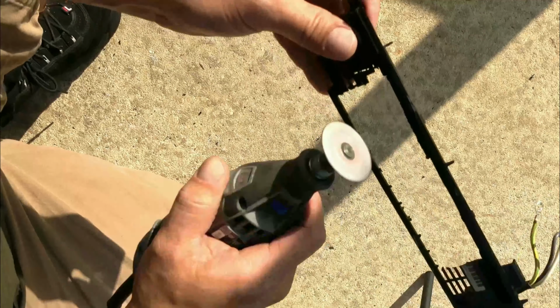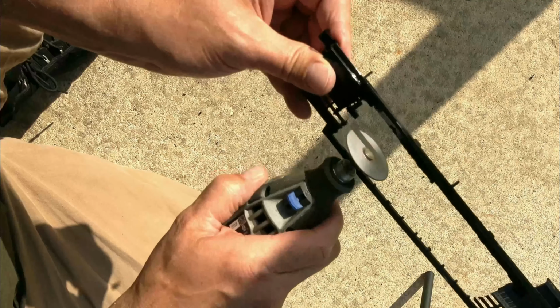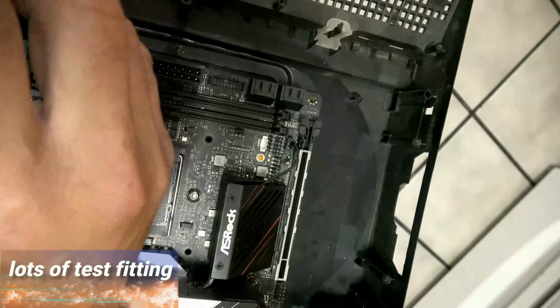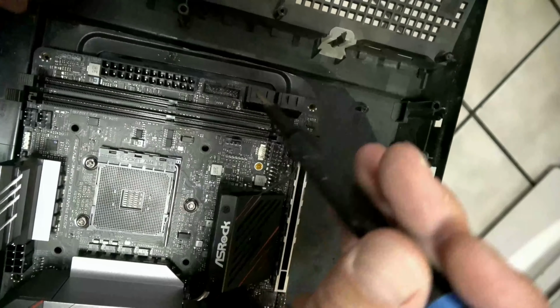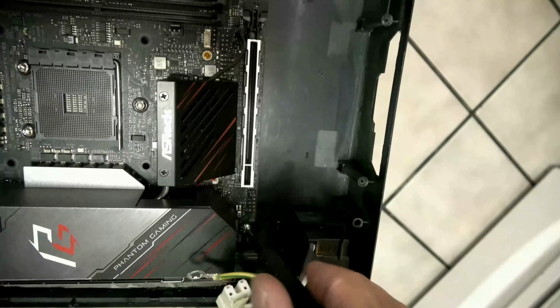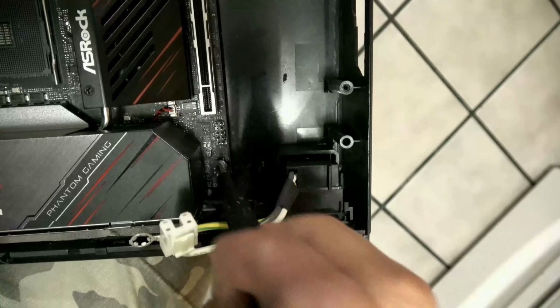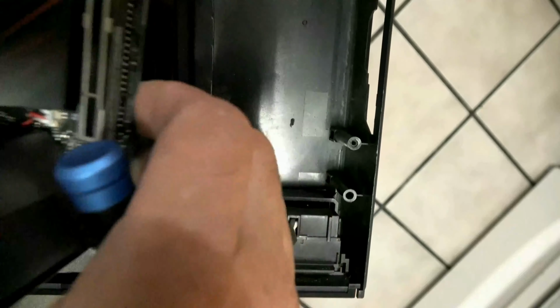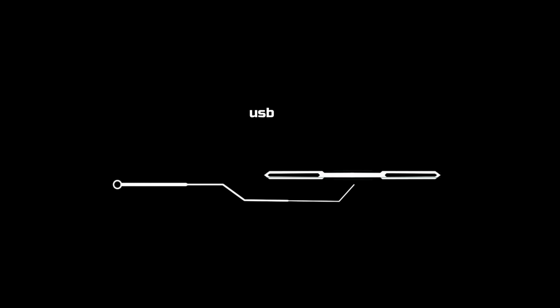A homemade motherboard tray from an old computer case and cutting out the rear of the PS3 to the shape of our I/O shield seems to be a good place to start this operation once the bottom of the PS3 was cleaned up. Attaching the mobile plate was done with small screws that I grinded off the excess to the bottom of the PS3, now test fitting over and over. Wondering about cooling runs through my head.